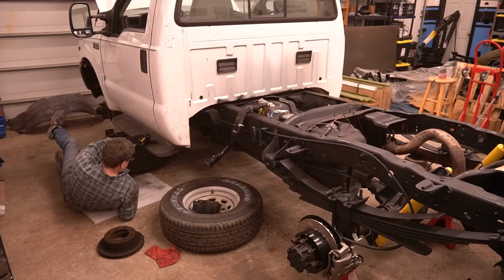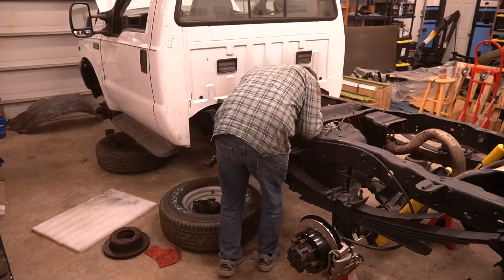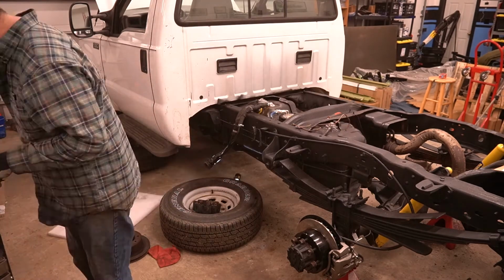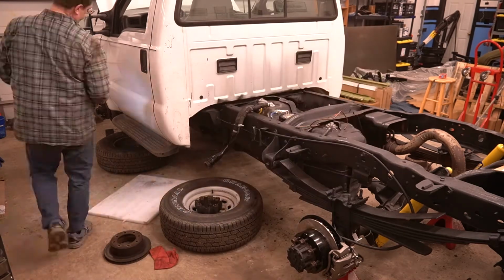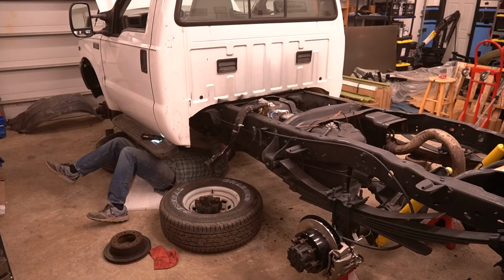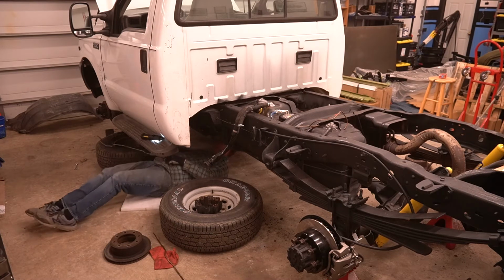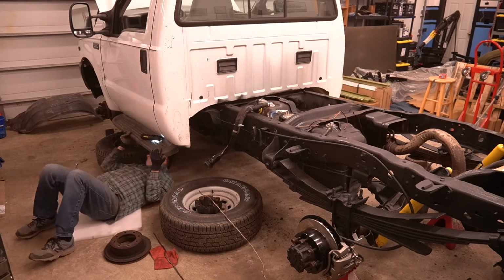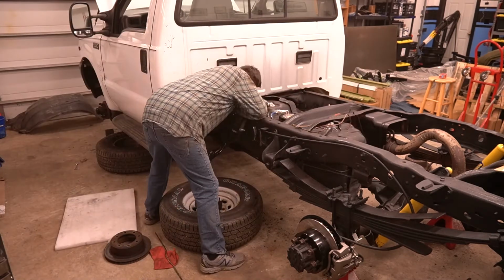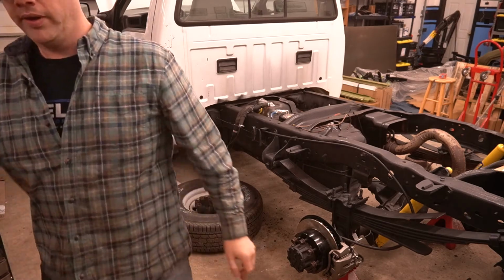Of course, we still had those crusty old brake hard lines to deal with. As I started pulling the 1/4-inch line that runs to the back wheels and basically having it disintegrate into pieces, I knew we pretty much had to replace every single hard line on this truck. And doing that also meant revisiting something from our earlier work and adding more things to our to-do list.